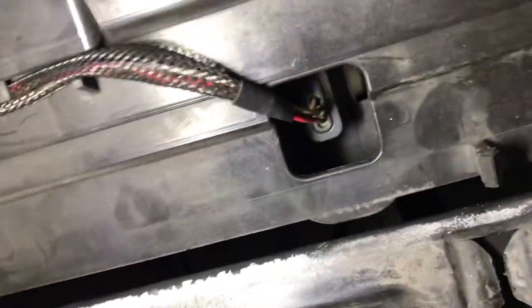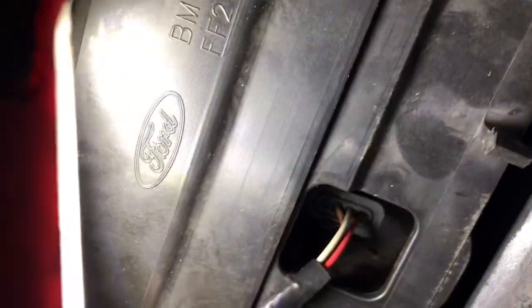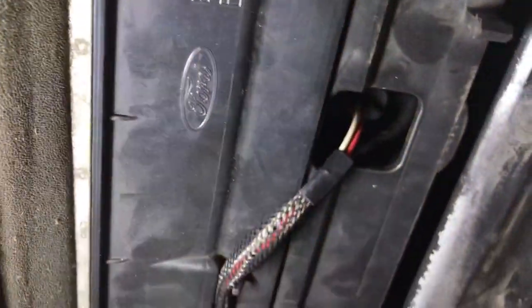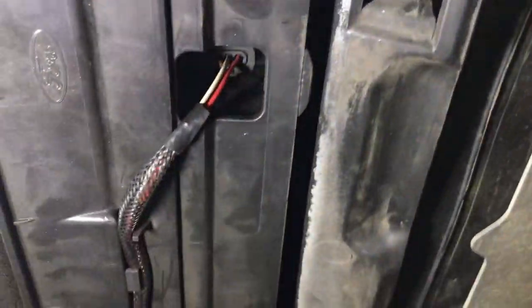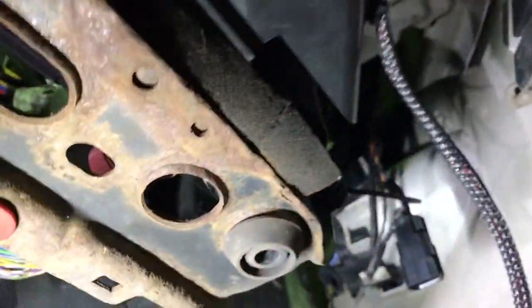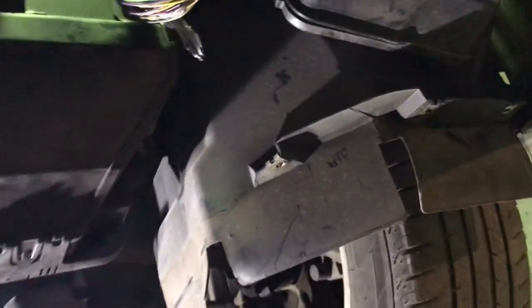In this case there was no problem with the actual grill shutter motor or actuator — it was a wiring issue and a regulator fault with the alternator. This plug is also known for water ingress and corrosion given its location, and cars that have had front-end collisions can suffer damage to this wiring loom, causing battery light and charging problems. Any questions, feel free to comment or message me and I'll put as much information as I can in the description. Thanks for watching.